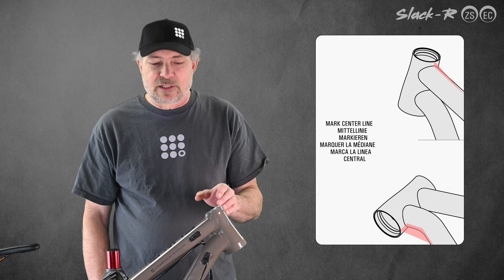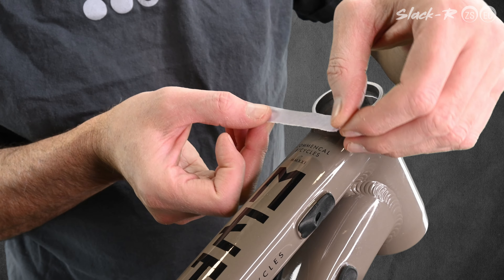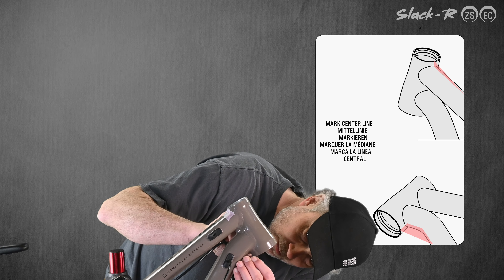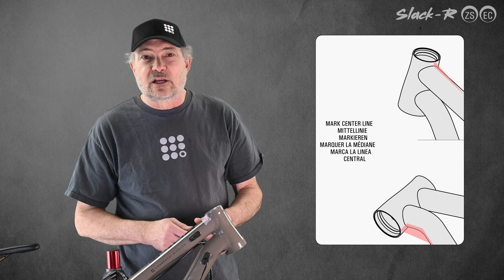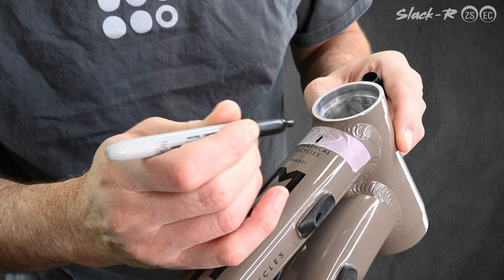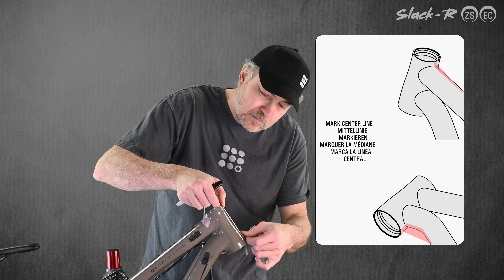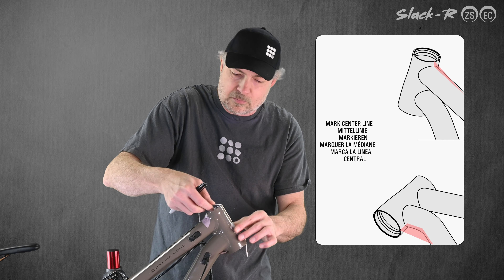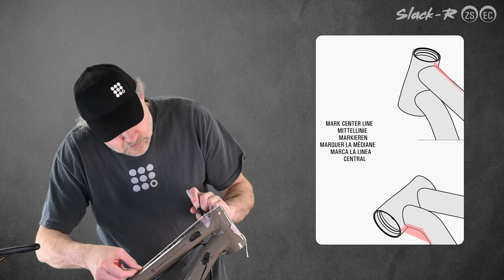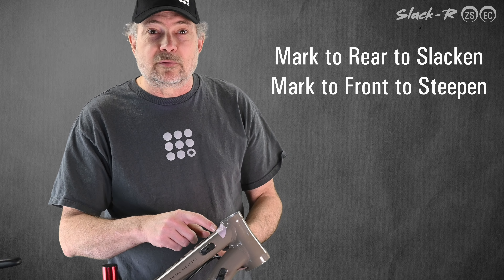The Slacker eccentric headset must be aligned to the centerline of the frame. Make a mark on the centerline on the top and on the bottom. I like to add some tape here to avoid marking the frame. If your frame has clear centerline graphics, this is easy — just make a mark. But for some bikes, you may need to string a line or find some other way to determine the centerline. Remember to mark the top and the bottom to the rear of the head tube.